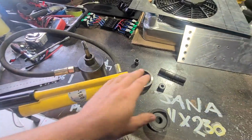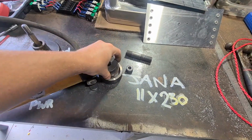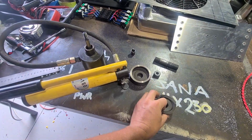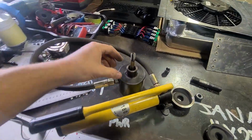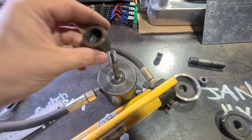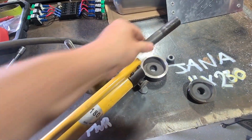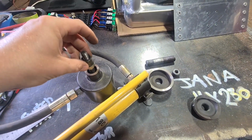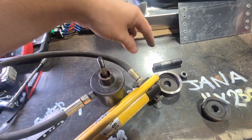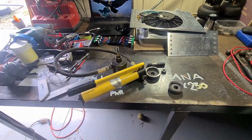So I'll just get those out from over there and show you what I'm working with. Alright, so this is the kit I've got. I can't remember what these are called for the life of me. But basically there's a die like that, and a die with teeth on it, and then you center it all over with the bolt that is just there, and then pull the 2 together, and it cuts a nice big hole. So you use this thing, which I would call a porta power, or a type of. So to get it started, you've got to drill a hole through your sheet that is the size of this small bolt. So I'll do that in a second, and then you put this guy on there, and there's this cutter, which is the same size as the big bolt. So you put your sheet on, you put this on, put the nut on, then you porta power it through so it cuts a hole, and take this guy out, put the bolt in, put that through the piece of metal, and then put these guys on it. So I'm going to do it in a hyperlapse, and hopefully it makes a bit more sense.